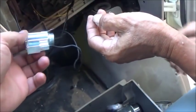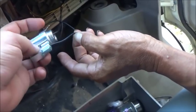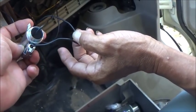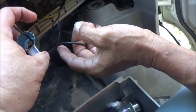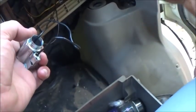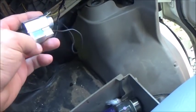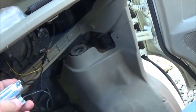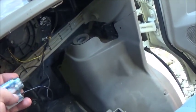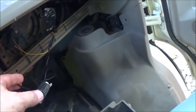It may be, Totai, that we need a wire here. Ground? Ground, maybe. I'm not sure. But this may be the ground here, and this could be just a light or something — who knows? We put the ground on this — yeah, we can ground directly to the frame. I'm sure one of these others would be a hot. So maybe we just don't have it grounded. This is a plastic dash.